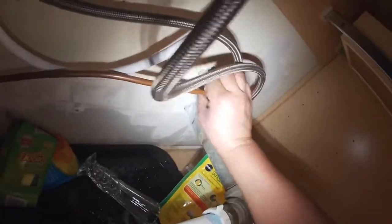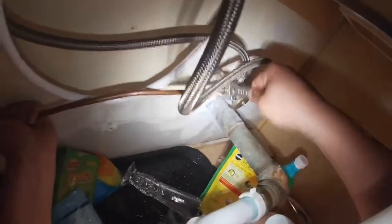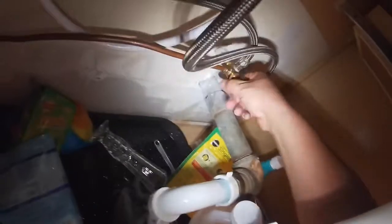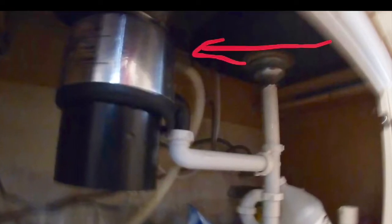Go ahead and install your copper line back and the water valve. Make sure you tighten the water line — don't over-tighten it or leave it loose. If you over-tighten it you will strip the thread and cause a water leak, and if you leave it loose you will have a leak as well. Install your drain line back in your garbage disposal, making sure the drain line goes all the way up and has that loop — like a P-trap — to prevent water from the sink from coming back into your dishwasher.